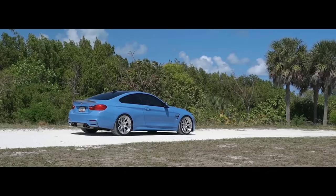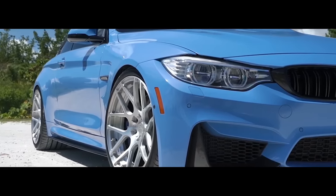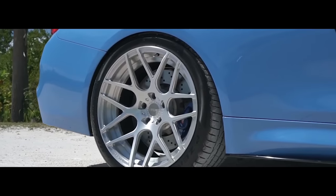A lot of people argue that tucked fitment can be done with just the wheel, just the tire, or the wheel and tire together — but in our eyes, the entire wheel needs to be inside the fender liner. The second and probably more common setup is flush fitment. If tucked is when it's inside the fender, flush means it's on par with the fender. People will say it's either the wheel or the tire, but in reality it's both. You want the wheel matching up to the fender liner dang near perfect.